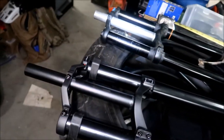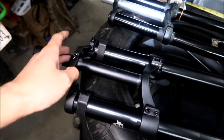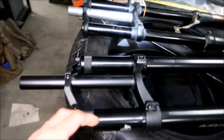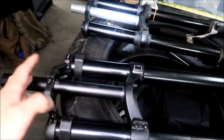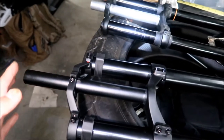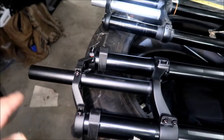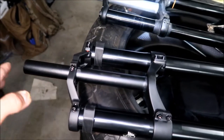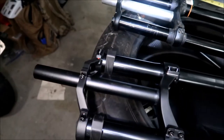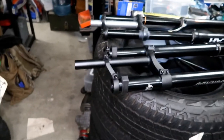What we've got to do next for this guy in the meantime is cut the steering head tube. I'm going to get the other fork out - my white RST fork that's been painted black - and we're gonna measure the stem height, then cut it to that height. The manual actually tells you to just measure the stem tube and then cut it, so I guess that's what we're gonna do. That's the proper way to do it.